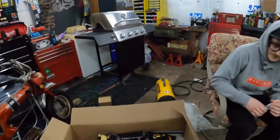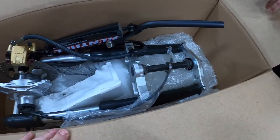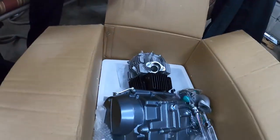Now that we got the bike cleaned up, we're gonna go over some of the parts we have for it. First, I got some suspension parts and a new triple tree, like a Honda Grom style, because you can see the forks are bent on this bike. Then we've got some new dirt bike style handlebars, and to power the thing we went and got a 125 that's a direct bolt-in. It comes with a kickstarter — I got the kickstarter one, though you can get electric start. This one is a four-speed manual so it comes with the clutch and everything.